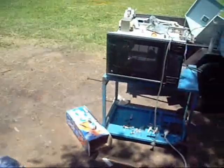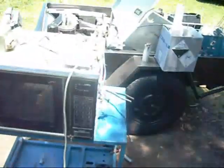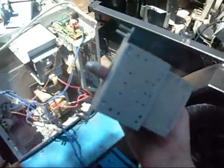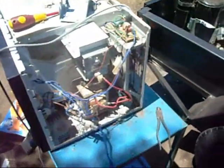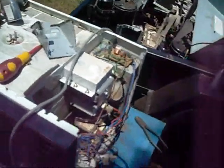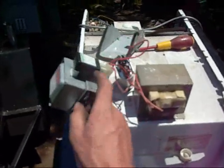It's fairly clean outside now, got rid of a lot of crap. Just playing with the microwave at the moment — doing something I don't recommend people do at home. I've already swapped the magnetron on this one out because it was pitiful. It's an old Samsung thing; it wouldn't even pop a light bulb, just get very hot, make the light bulb glow, melt the filament wire, and that was about it. So that one's going in the bin. I swapped it out for a really big old Matsushita magnetron — it's a 2M157-M2 — with its matching run cap, all diodes, and microwave oven capacitor.